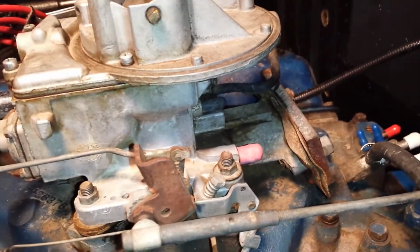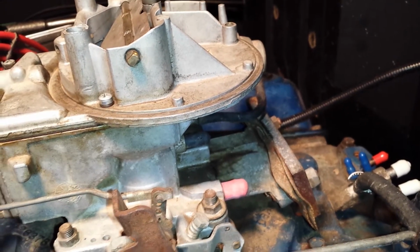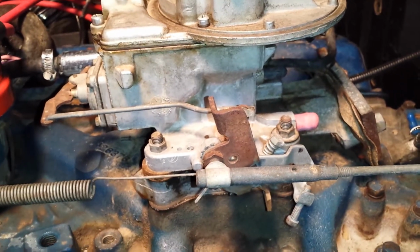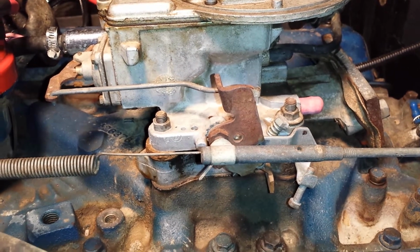I've tried spraying carb fluid all the way around there, and I can't get any higher RPMs, although it's running full choke, so it's already running high at RPMs, usually around 2,000. As soon as I open the choke, it won't idle at all. It just dies.